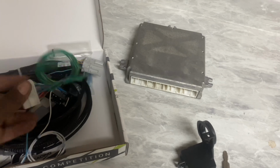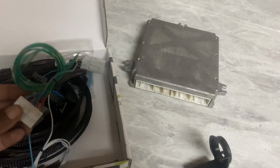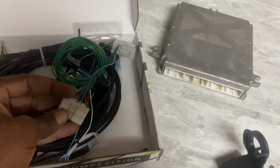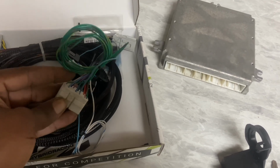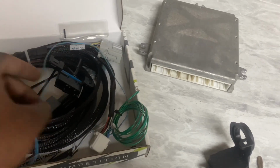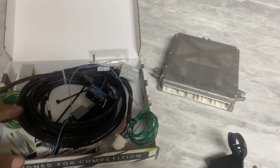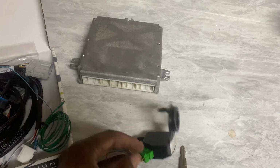Like I said, it's literally just one wire you have to run. If you're using the K-tuned immobilizer kit, it's the same thing. They got one more wire though, and that's pretty much to disable. It's not a check engine light, but it may come out as a pending code. I believe it's P0500 or something, and that's communications. So don't have to worry about that. It won't affect your performance or anything with the actual car. It's just like when I do the bars, you can't really have any pending codes at all, so I use that instead of this to get the car started up.